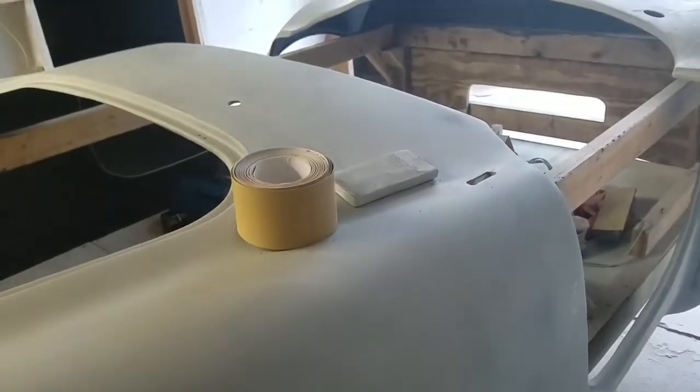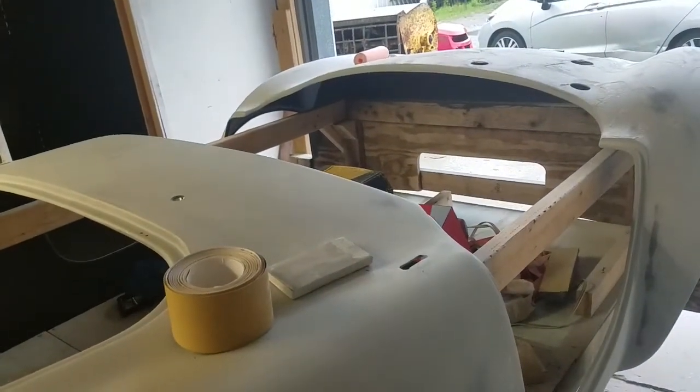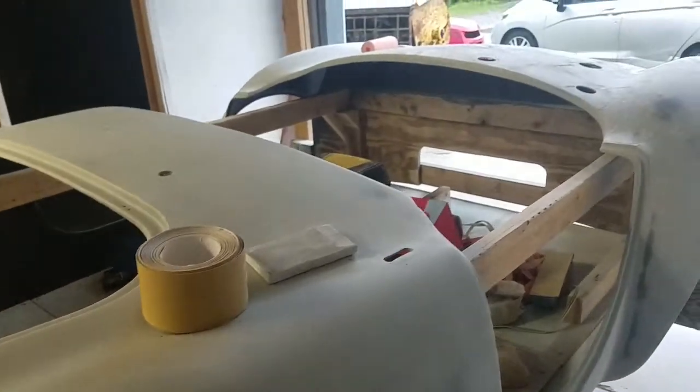And then I got to the trunk, and the trunk was larger, and the outside of the trunk took me maybe an hour and a half to get everything in plane. So I tried this, and then there was going to be the hood. So I decided the hood I'm going to hit it with 80 grit, and then I'll come back with 220. I think what I understand that you want to do is hit it with 220 and then even 400 afterwards before doing an epoxy sealer.